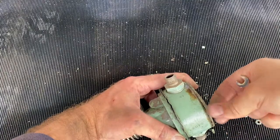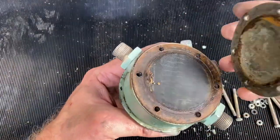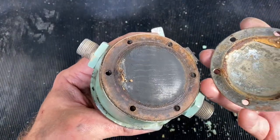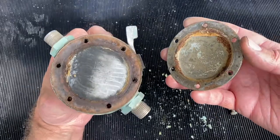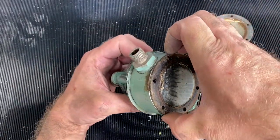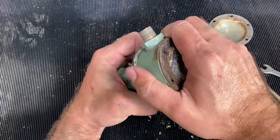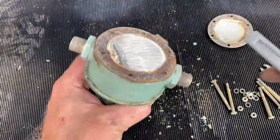I'm doing this pump rebuild because I've started to notice a little bit of petrol in the oil on the Daimler Ferret, and one of the classic ways in is through a torn pump diaphragm into the sump. So that's the rear cover, and this is the pulsometer diaphragm on the back of the pump, which is a thicker diaphragm.